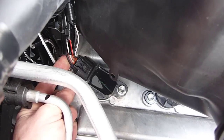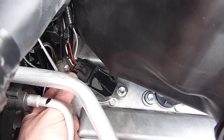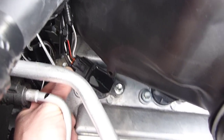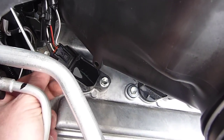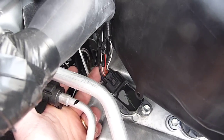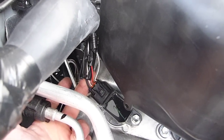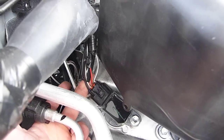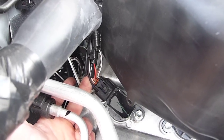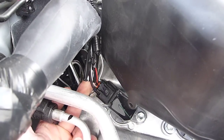It doesn't really make much sense on older cars, but some of these injectors have two wires, some have three, and some have four. Even though I can't really show you the other injector wire, you're just going to have to take my word for it. There's a black, there's a white, there's this one here which is orange-yellow — which is the one I grabbed — and then there's that white-black. On all of these injectors, there's going to be three wires which are going to be common.